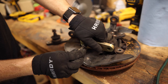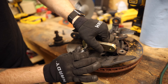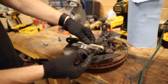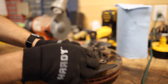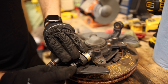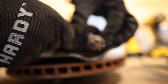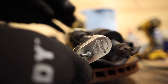The install is super easy. There's three bolts in the bracket. One of the bolts has a shorter head — that's the one that goes inside this little recessed spot here. You got to get yourself a 10 millimeter hex head. Basically, this is where it would mount up normally. With these brackets, it's just moving it out — effectively just kicking the bottom out. The longer bolt goes through both the ball joint and the bracket, and then there's another short one that goes into the threaded spot on the bracket itself. And that's how it all sets there.